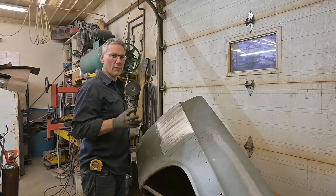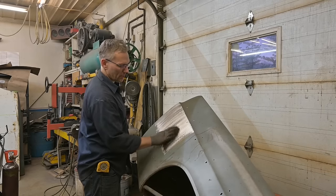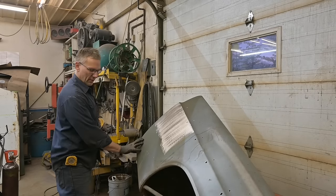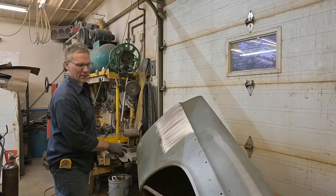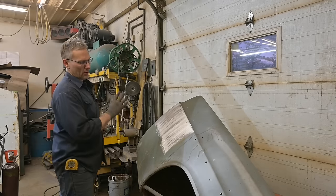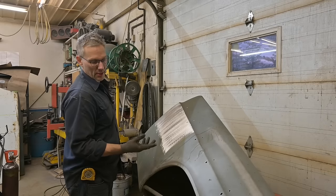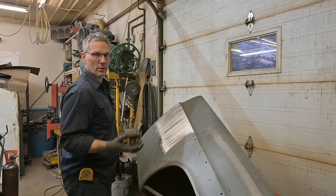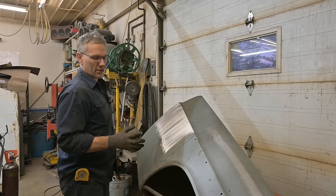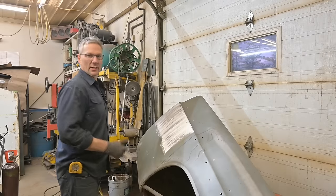These fenders are just over five feet long and you can only do that for so long. I'm not building up any heat — just very carefully stripping the primer as well as the epoxy primer, which really isn't too bad. A little bit of filler down here — I applied the torch to it, it kind of bubbled up, it's not very thick. We're going to take the stripping disc and just remove it. We're going to systematically go over all these fenders, all the body panels, and just bring her down to bare metal on the exterior. Inside, they have that sound deadening on — wherever it's loose we're going to take it off, but if it's stuck on well, why disturb it? Exterior-wise, we have to bring it down to fresh bare metal. Let's get back onto that inner web.